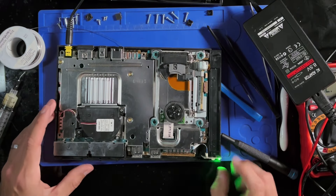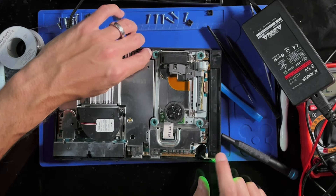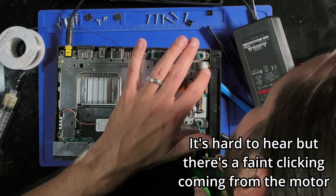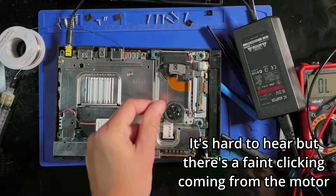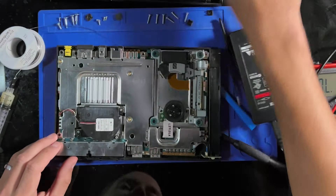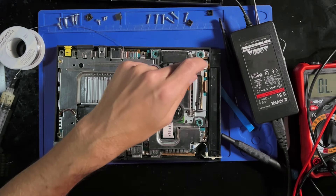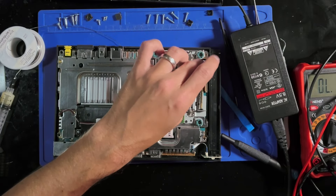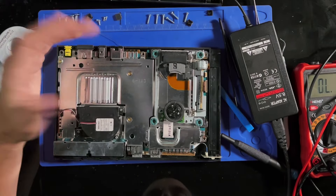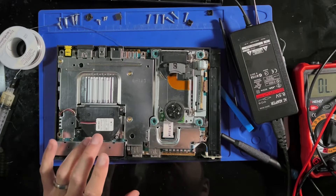Green light. Still nothing. I think it's the motor. What I'm going to do is look for a different laser assembly that might fit this, to see if this assembly is dead. It sounds like it's trying — I know these are working — sounds like it's trying and maybe this motor is dead. We'll try. And for the other one, I'm going to look and see if one of my donor boards has a fuse I can borrow.